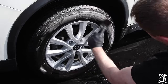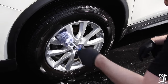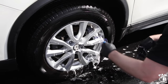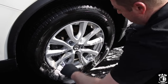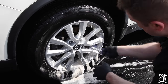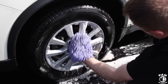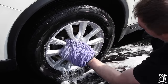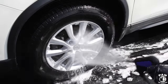As you can see there was still a bit of browning left, but on the third try the foam is white, so the wheels and tires are clean. Next I'm washing the inner barrels of the wheels using the Microfiber Madness Incredi-Brush flat brush — it has a microfiber tip and flexes enough to get into the inner barrels. I'm using Chemical Guys Citrus Wash and Gloss soap. For the faces of the wheels I'm using a microfiber wash mitt. I'm using a dedicated wheel bucket — a third bucket separate from the two I use to wash the paint — so I'm not cross-contaminating.